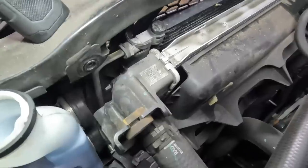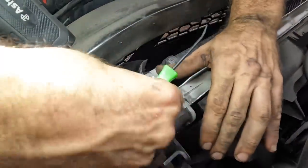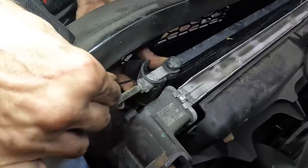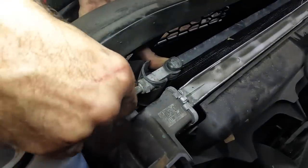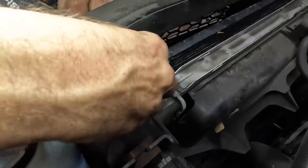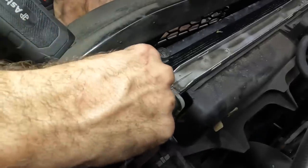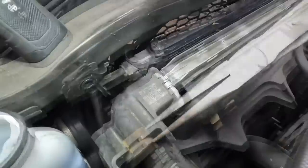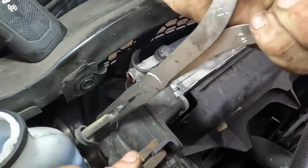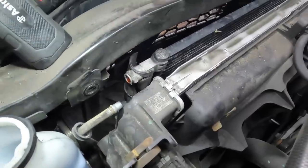Okay, we have moved over to the driver's side, and that's where the other transmission, not power steering line, is located. So I will remove this one in the same fashion. We'll just get behind that little clip without stabbing my finger. That would hurt. I love getting injured at the beginning of a tight job. That's always fun. Let's pull that out. There we go, clip number two. Same protocol. Go in there with the pliers and just kind of encourage that to come out. We've got our fluid spillage going on right there. No matter, it's gonna happen.